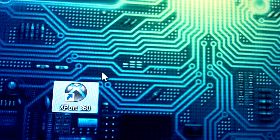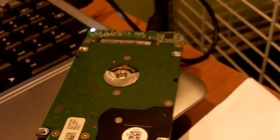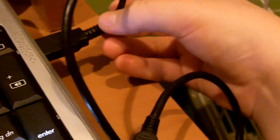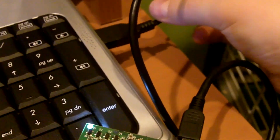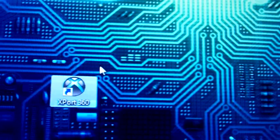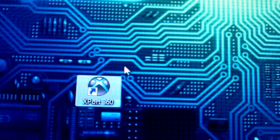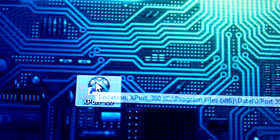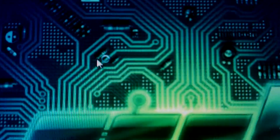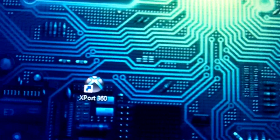Now all you have to do is take your connected cable and plug it in. On your computer, take your Xbox hard drive with the adapter and cable plugged in, and plug it into your computer - however your external hard drive PC adapter was made, so it may be USB or FireWire. You're going to need a program called Xport 360 - I'll give you the link. Open it by right-clicking and running as administrator, or else it won't work.